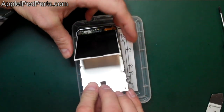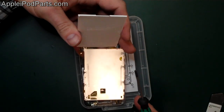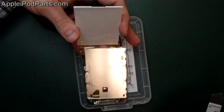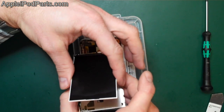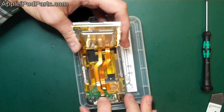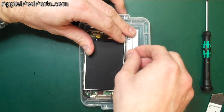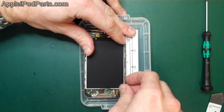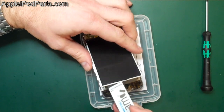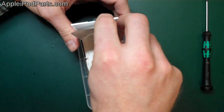Battery comes in over and the screen is obviously going to come in here. Now, one thing you might be able to see is on the screen itself, if I try and bring it in, you've got a little plastic circle there and a plastic circle there. They locate there and there when it all goes back together. So you're going to lift the screen over, just tuck it in there roughly where it sits, and you're going to go right, okay, paranoia check on that connector, that's in place, and we're just going to drop the plate down, tuck these little clips underneath that bezel, and what we can do is lift the screen and just try and position the plate under there. Silver membrane that we don't really want to lose off of there.